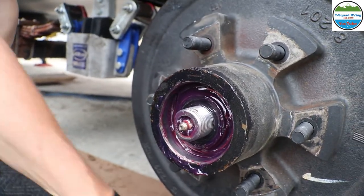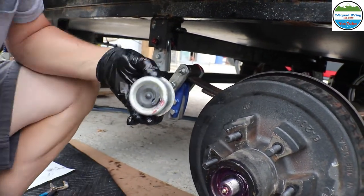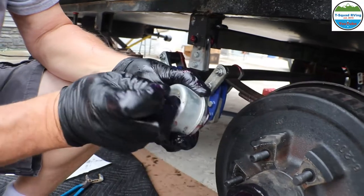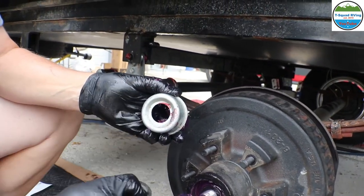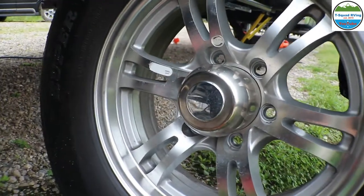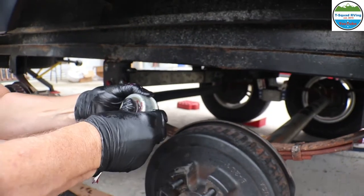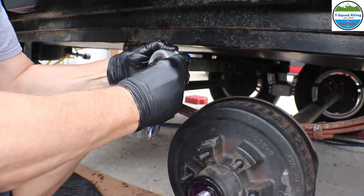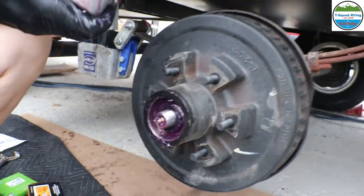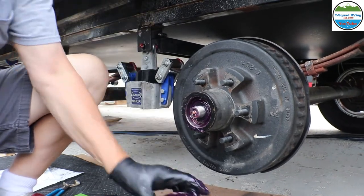It's accessible through this dome here by popping this rubber out. You can get at it when you take this rubber off, and this will come out here, and then you can access the insert through there. And I think the end of the rim has the pop that pops off to access this. So you can get it all out, and then you can just grease the bearings, once every few months, or a couple times a year, whatever you need to make sure you got plenty of lubrication in the wheel bearings. And we got plenty of lubrication. No, we got plenty now.